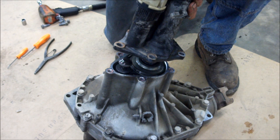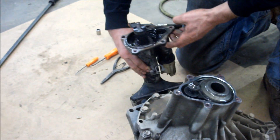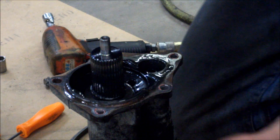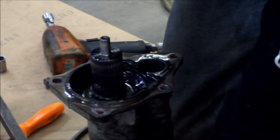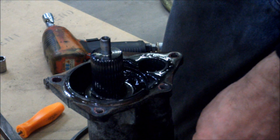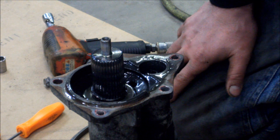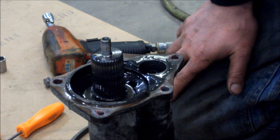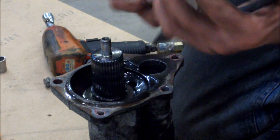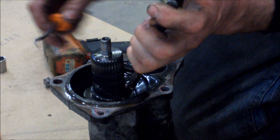This piece comes off the passenger side of the differential — five bolts hold it on. The snap ring, as you pry on this housing, is supposed to release and squeeze in to allow that shaft to come out. On these it's a real bear — they don't like to come out. It looked good on paper, but it really didn't work that great. To get this shaft out so we can replace the seal, we go ahead and take this snap ring out of the way, and then we can pull that shaft out.